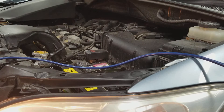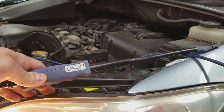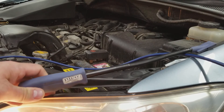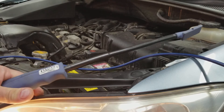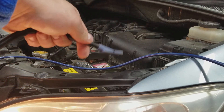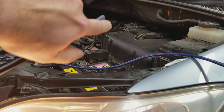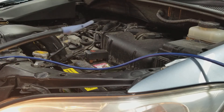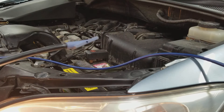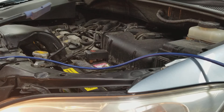What we're going to use — since this is a coil-on-plug car — we're going to use the Pico TA204. This tool has a nice flexible end on it so we can sneak it under intakes and stuff like that. This paddle will go up against the coil on plug and allow us to visualize secondary ignition.